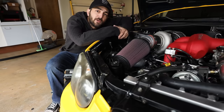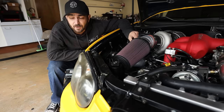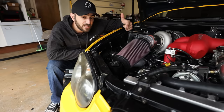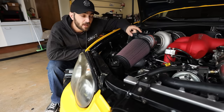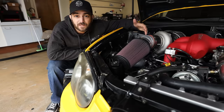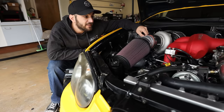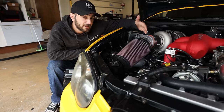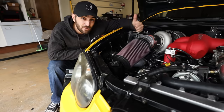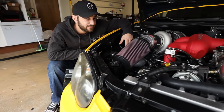Another thing that can lead to premature wear is hammering on the car light to light. I see this a lot locally with WRXs and STIs — red light, 100% throttle pulls. Going 100% on the car for short intervals puts a lot of wear and stress on it. When you're only going 500 feet to the next red light, there's no need to hit 28 psi. You're also sucking in high IATs, stopping, letting everything cook, then sending it again. Let things cool down.